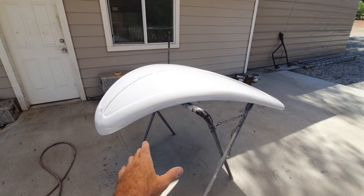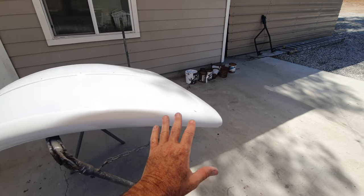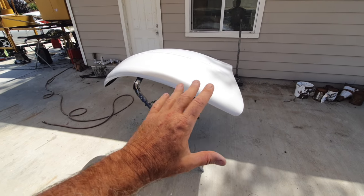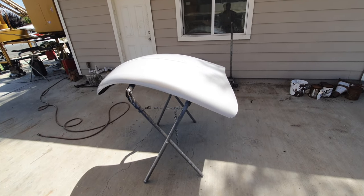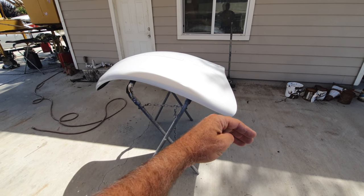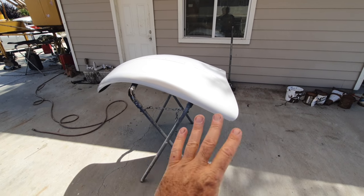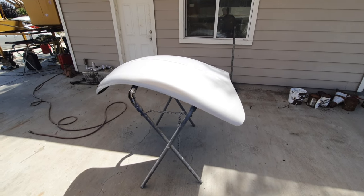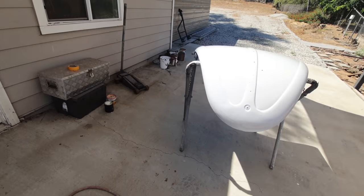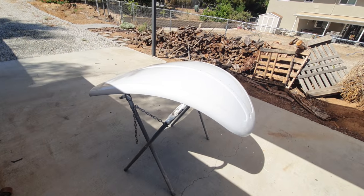So what I wanna do when I get to that point is I'll bolt this back on the car, and then I'll have a nice firm surface. I can check my lines. I can do the final sanding and do the final block work, little things that I want to fix. There's more filler that I'm going to put on there and do all that after it's on the car. This is just kind of a rough end. Okay. So if you're looking at this and you see flaws in it, of course it's going to be, we're not done. We'll bring this back, bring you guys back in.